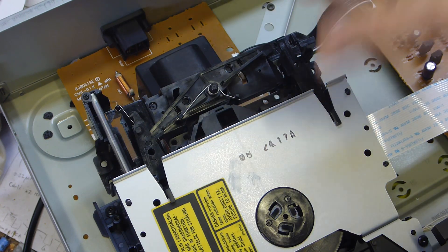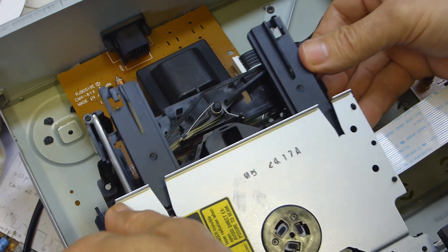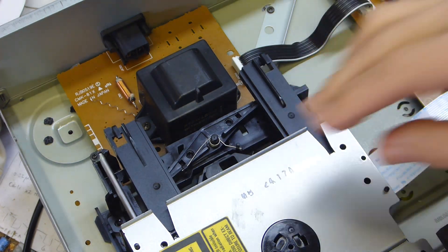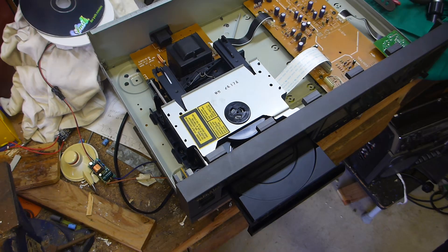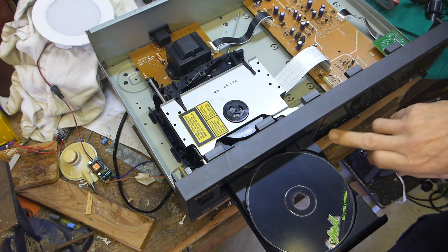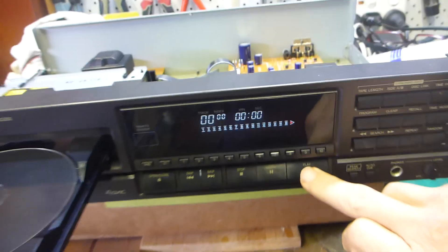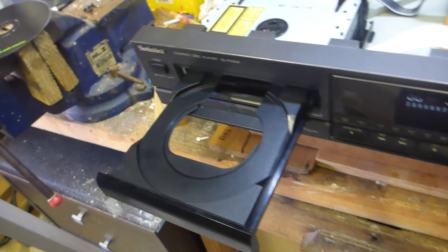When the drawer comes out all the way, these little fingers hook into the top of the plate and stop the drawer from flopping down too much. Rest that down in its seated position. Power this on - the microswitches should tell it that it's not open and not closed. Okay great, opening it - and we've got 'Reading Disc'! Pressing play - oh ho, signs of life! How good is that! Now I want to try a very poor condition home-burnt disc - greatest number one singles - see if this reads.